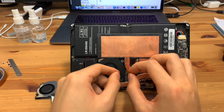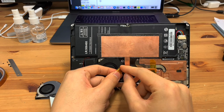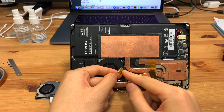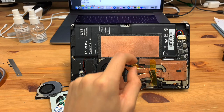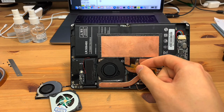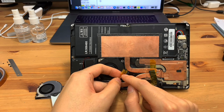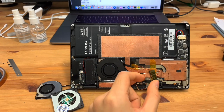And I tack soldered them onto the back of the flex cable for the MacBook Air's fan. You just have to tin the pads, the gold pads, with your soldering iron, and put a little flux on there. And you very, very carefully do that. Putting some Kapton tape on it helped. That's sort of a micro soldering job, though. These wires are very, very thin, and if you haven't soldered very much before, it would probably be quite difficult. This actually took me quite a few minutes, but long story short, I soldered the red wire to the plus marking on the flex cable, the black wire to the minus, and I think there was a pin labeled A, which corresponds to the tachometer pin, which I put the yellow on.